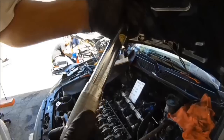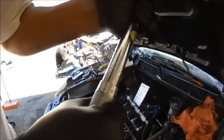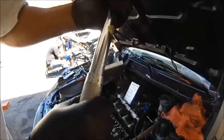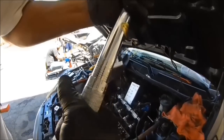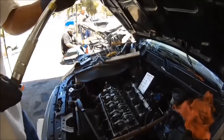Set the zero at 40 — in the center between 30 and 50. That's 40 right there. Now take it to 49 — 42, 44, 48, 49 foot pounds right there — almost 50 foot pounds. Completing all ten bolts at 49 foot pounds in sequence.